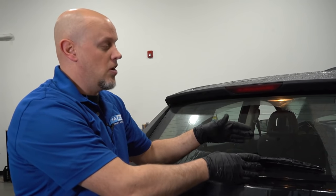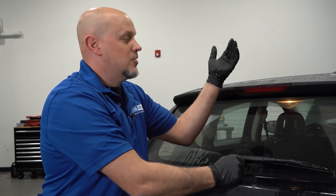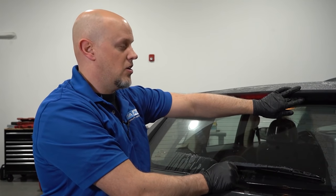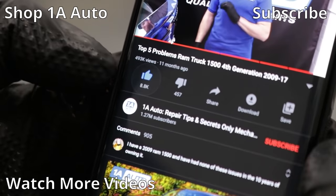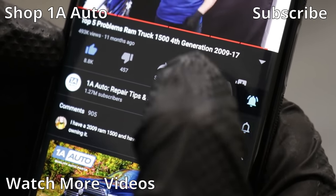So that's all set, it's good to go. We just need to clean up some of the washer fluid inside there, put the panels back together, and we'll be all set. What probably happened was there was some ice damage — something was clogging up the washer nozzle and that caused the hose to pop off. That's my assumption anyway. If you have another idea, leave a comment below. If you enjoyed this video or it helped you out, make sure you subscribe to our channel, ring the bell, and turn on all notifications so you don't miss any of our videos.